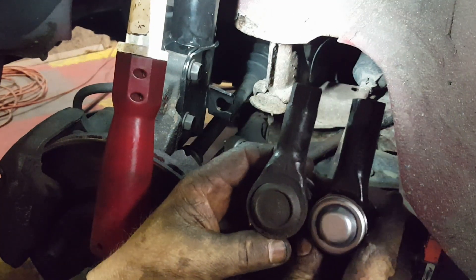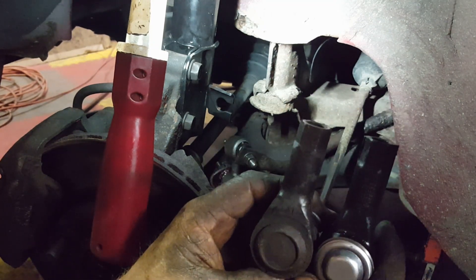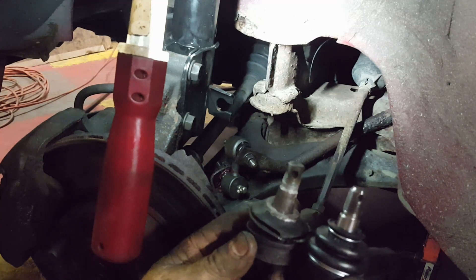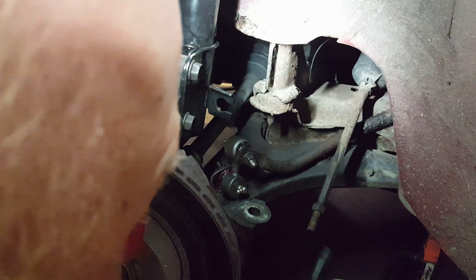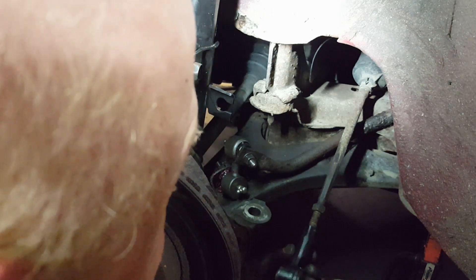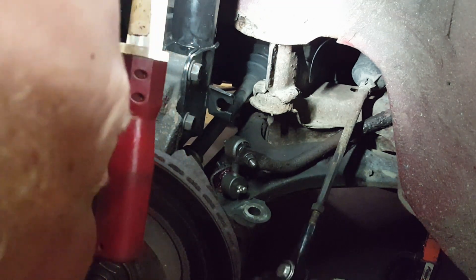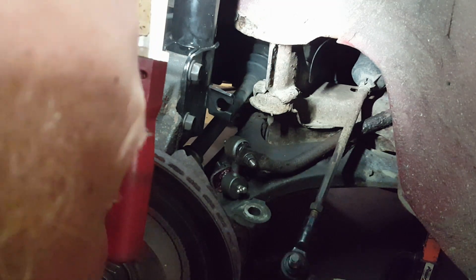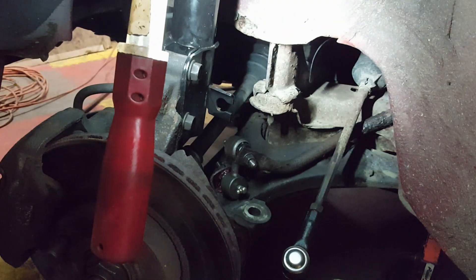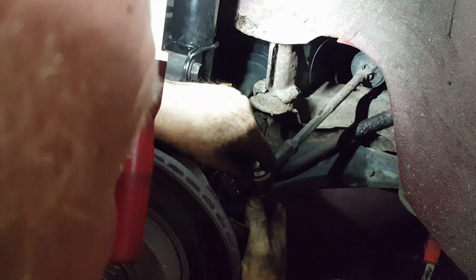Comparing the new next to the old: dimensions from the center out to the face appear to be the same, and the nut here appears to be the same. I said 18 and a half turns, so we start here — half, one... 17 and a half, 18 and a half. Now check the measurement: 11 and 11/16ths. We're good.